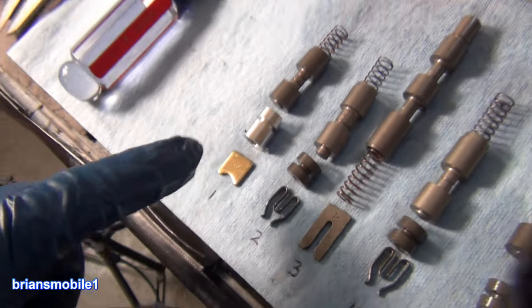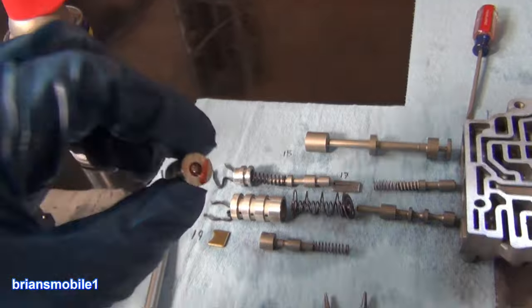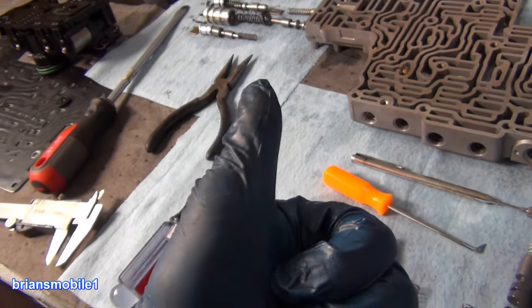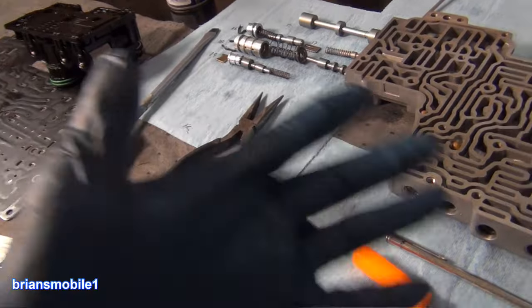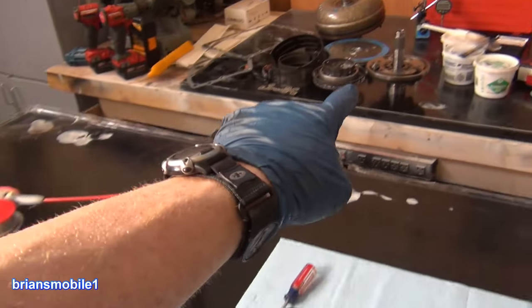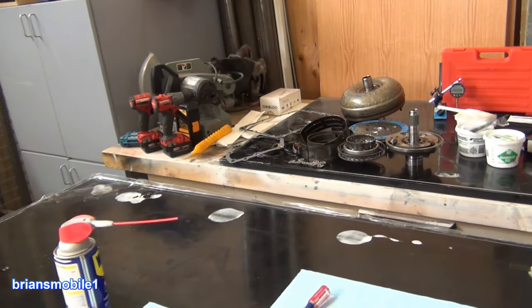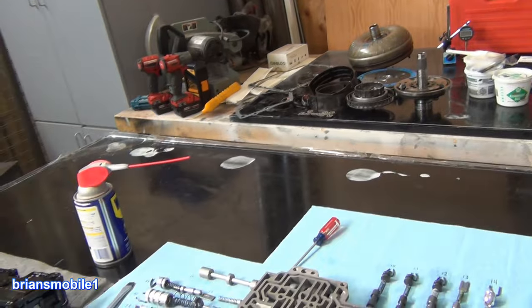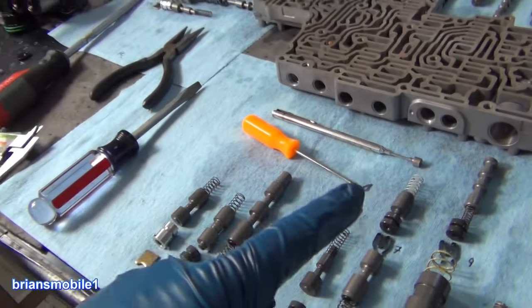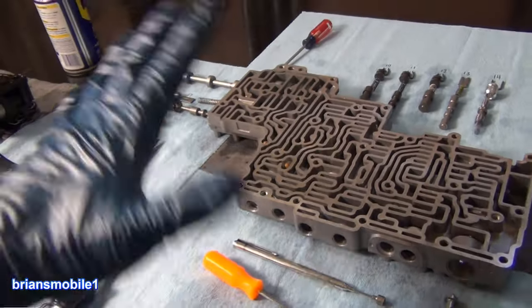This one looks a little different — that's because it isn't the same as mine; it has these pressure relief check ball valves that come with a Transgo shift kit. The nice thing about the Transgo shift kit is it comes with a torque converter alignment tool for your front pump so everything's happy when you put it back together, no leaks. I really like their design on the flow control valve — that little valve right there can cause you to lose all pressure in the transmission and not move forward or reverse. If it does catch a little and you try to drive, you can lose your overdrive planetary, overdrive bushing, your whole front pump. That's what this failure was. I actually had a bunch of metal stuck in this one, this one, this one, and this one, so we had to tear it down and clean it.